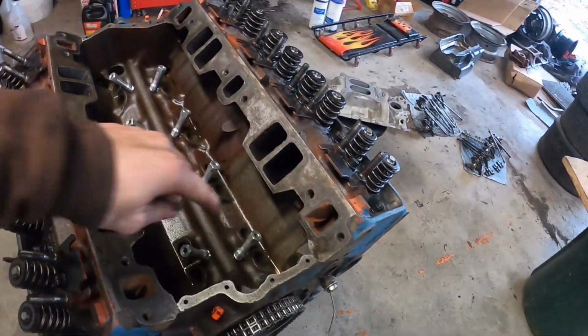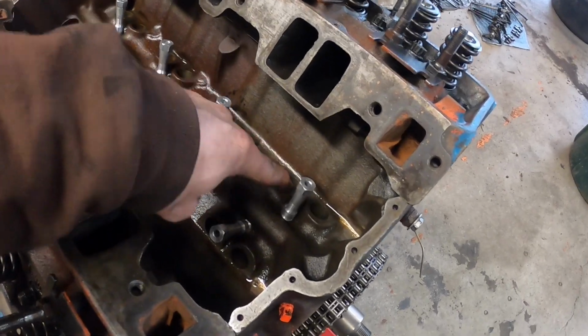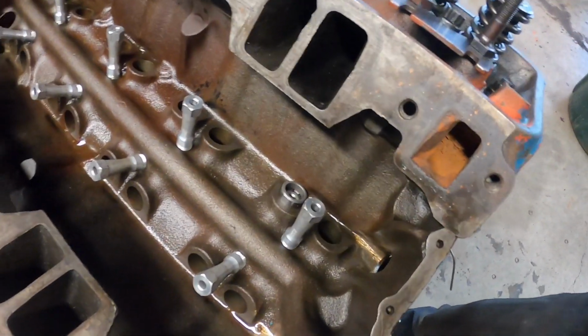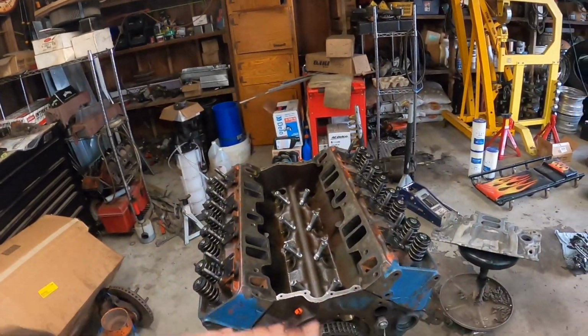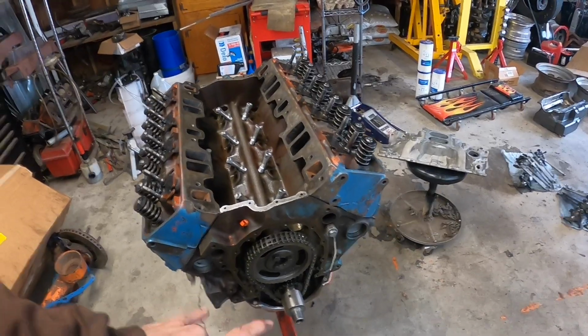First thing I have to do is stick a lifter in the cylinder number 1 intake lifter bore right there. All right, it's in. I'm not going to get into a lot of detail in this video on how all the degreeing works. If you really want to know that, watch the last video that I'll link in the description from when I did the super truck. But I'm just going to show you real quick how to do it with the cylinder head on and what I got with my intake centerline.